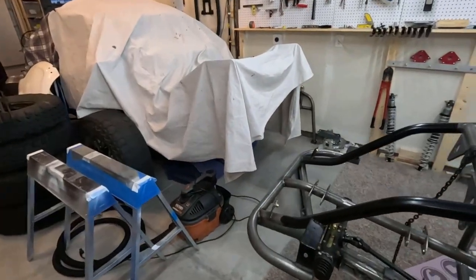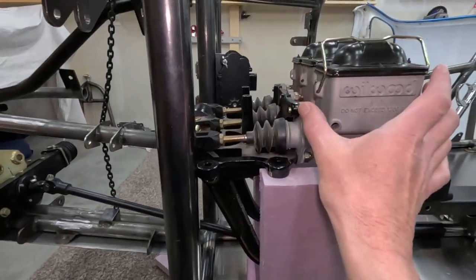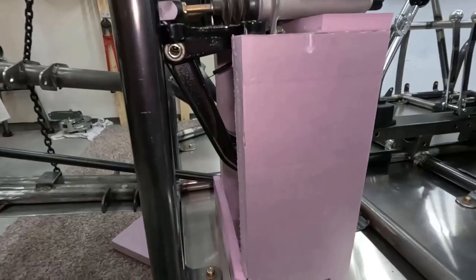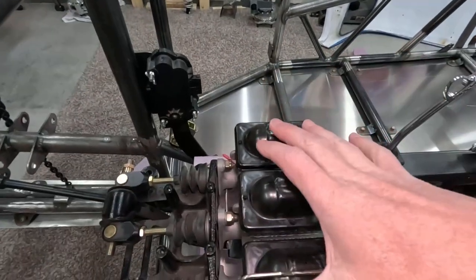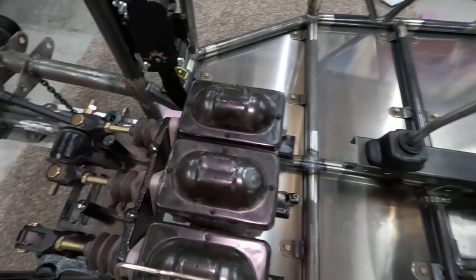Ratchet over there has what's called a regular hanging pedal assembly. And on that one, all the master cylinders hang on this side. So on Ratchet, they actually sit outside here. I was hoping on Mauler here, I could keep using these on the inside, but I don't think that's going to work. I think it's going to be in the way of the steering shaft too much.